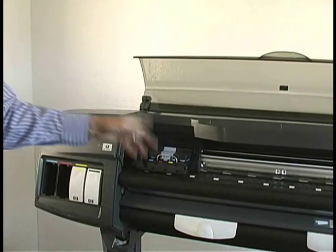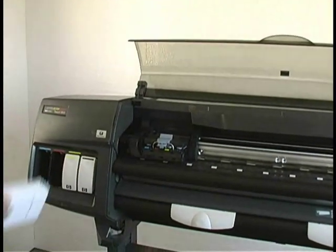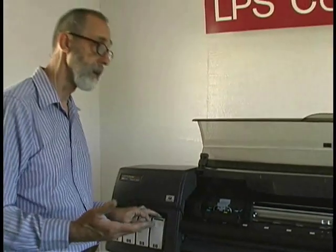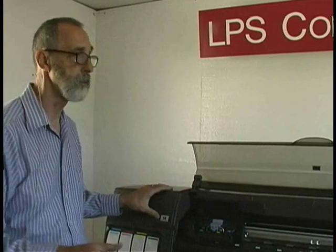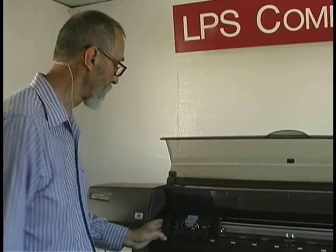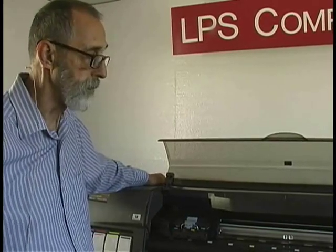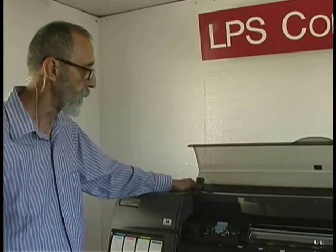I didn't mention earlier, but there's a counter on the ink tube system chip itself counting how many cycles the carriage goes back and forth. At six million cycles it gives you a warning that you need to change the ink tube system. At six million five hundred thousand, the machine stops and says change it or it's not going any further. I've never seen a tube system last that long, but that's what the chip is for. We reset that chip back to the factory, so this actually thinks it's a brand new ink tube system when you put it in the machine. As far as I know, nobody else knows how to reset them - that was something we interpreted the code ourselves and came up with a device to reprogram.